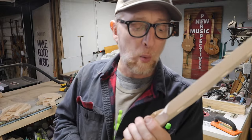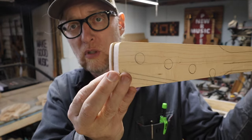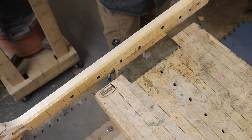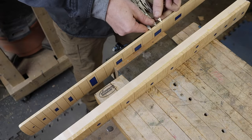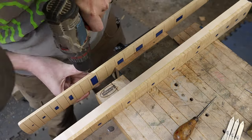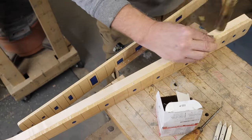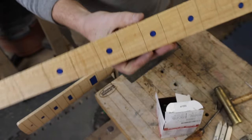When you set it up, you should have just a tiny bit — maybe an eighth of an inch — of overhang on that end. I forgot to mention that earlier, so you didn't do anything wrong. You could snug that up, but then you'd see the seam a little more; it's just a nice way to hide it. Now I'm using my center square to mark where I'm going to put my side position markers. I always use the stems of rivets — little eighth-inch aluminum stems — they make nice little shiny markers and I don't have to buy anything.